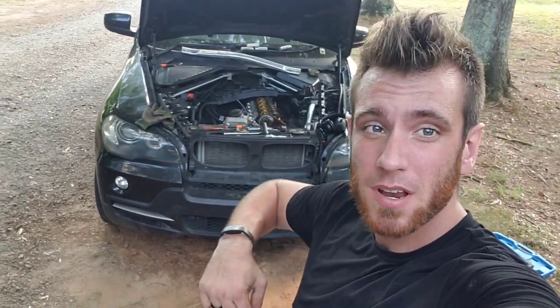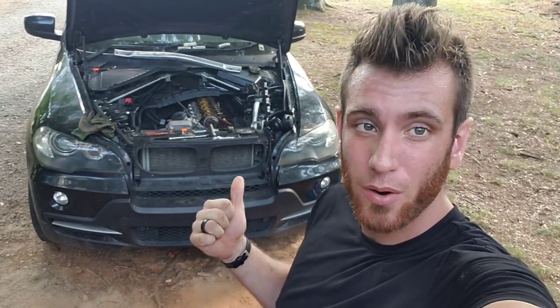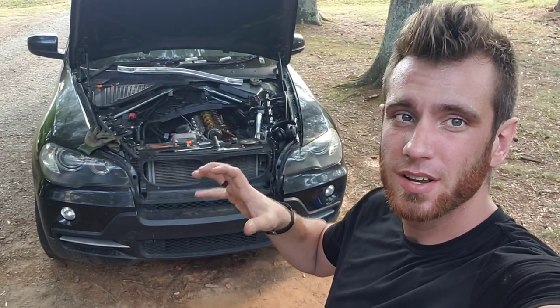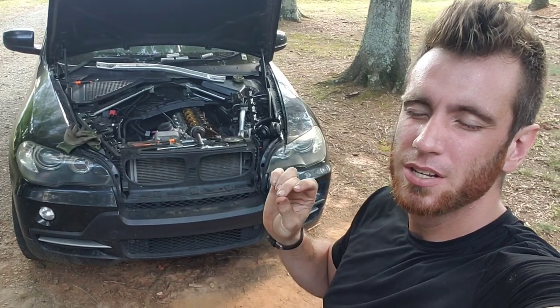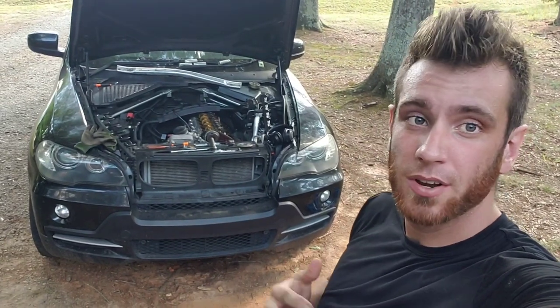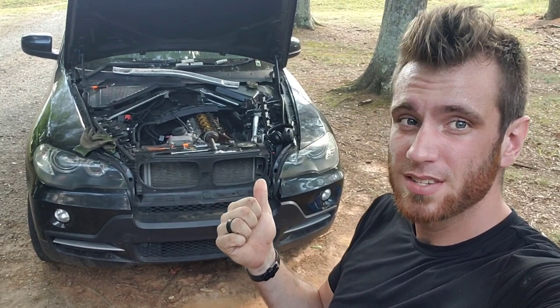As always, don't forget to check the video description down below for the best price on tools and parts I use in today's video. Today, hopefully you're watching this video before it hits the fan. I'm going to be talking about the Vanos gears and assemblies. It's like a 2A82, 2A83, 2A87 — these are the codes that can be thrown up. And a lot of times you think you can just put a little Vanos solenoid in, but a lot of times it's actually this.